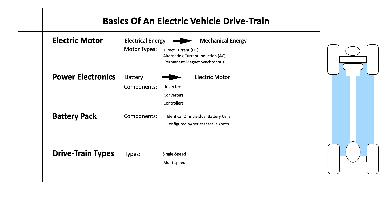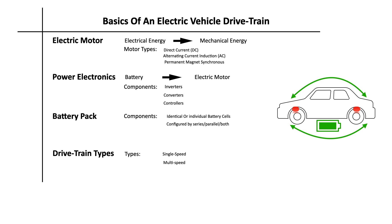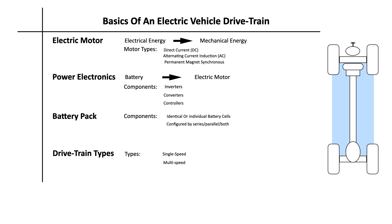Another important feature of electric vehicle drivetrains is regenerative braking. When the accelerator is lifted or brakes applied, the electric motor operates in reverse, converting kinetic energy back into electrical energy and driving that energy back into the battery, making the EV more efficient. Electric drivetrains are also up against challenges — primary among those is managing heat and delivering adequate range. In high voltage systems it is even more sensitive, and many trade-offs in electric vehicle development involve complex decisions around these aspects and safety.